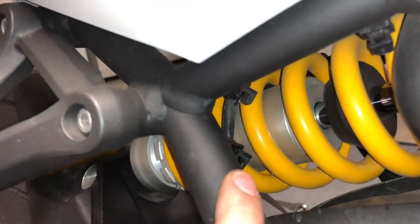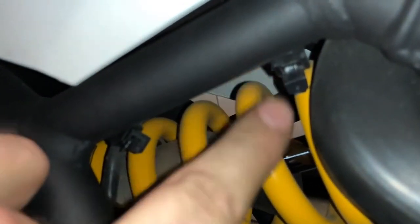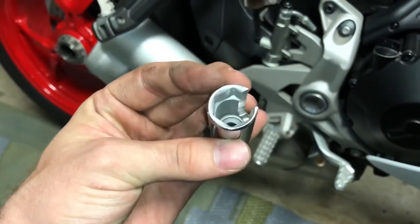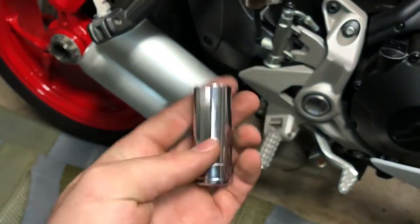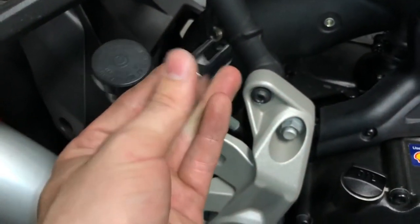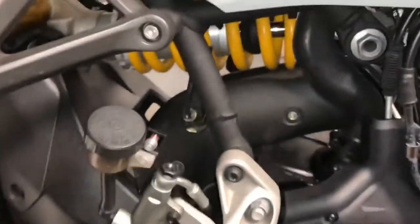The next thing you're gonna need to do is cut these little wire ties — they're hard to see but there's one there, one there, one here — a bunch of them that hold the O2 sensor wires. You're gonna have to cut those ties off so we can get in there and remove the O2 sensor. The best way to remove that sensor is to use a special tool — and if you don't have it, don't worry, the kit comes with it. It allows it to slip past the wire so you can loosen it.